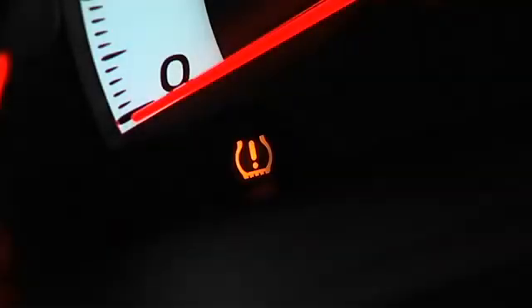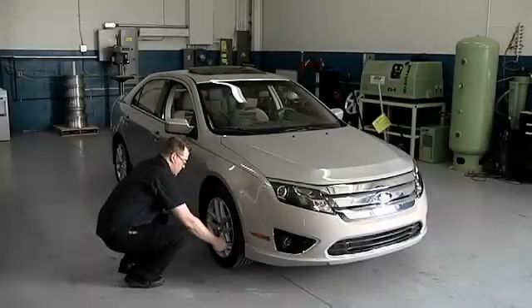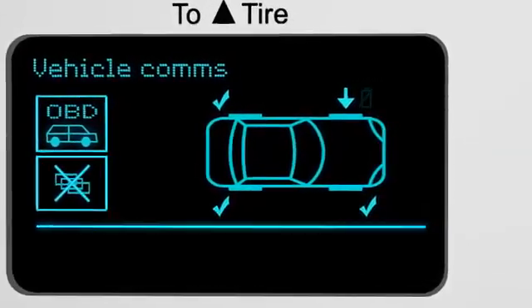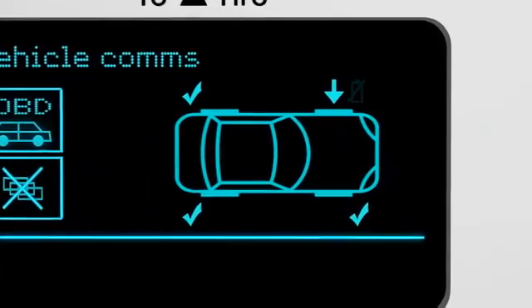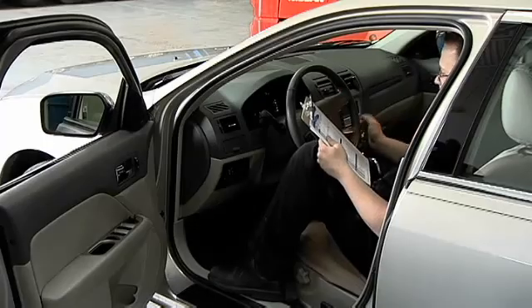First of all, let's follow the recommended test before you touch process. We enter the make and model year of the Ford Fusion and then proceed to test out all the sensors on the car. The test result on screen shows that the TPMS on the front left has a faulty battery and therefore needs to be replaced. You can now get the go-ahead from the owner to replace the sensor before you have touched the car. Test before touch.